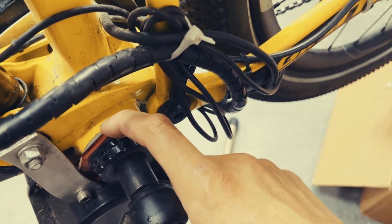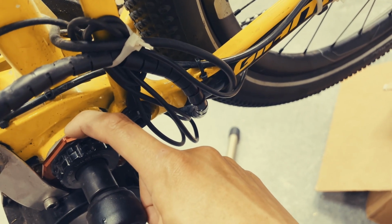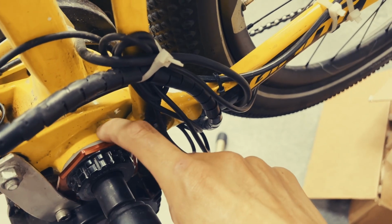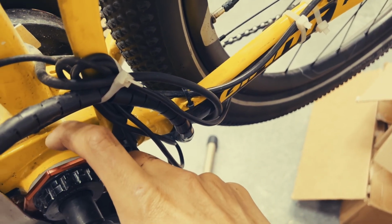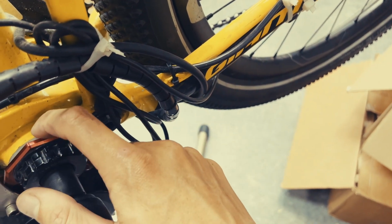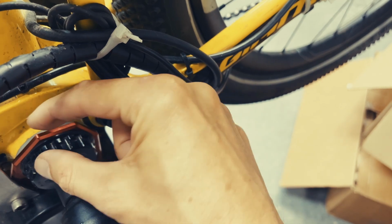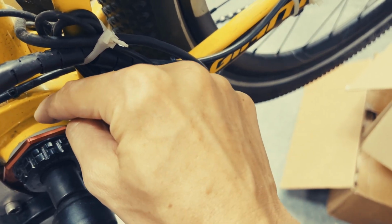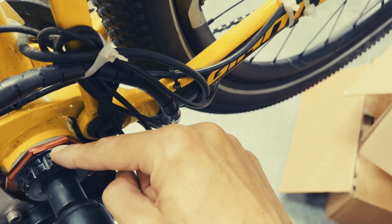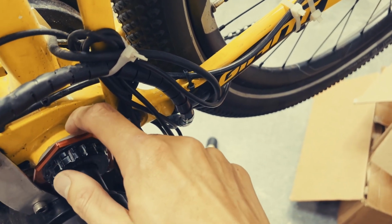So what some people do, and the link's in the description to the post that I followed but didn't follow because I didn't go their route, is they essentially, in a lathe, carved out bushings that went inside of the bottom bracket, but then also came out and created a washer between the actual mounting hardware, the spikes, on the Bafang motor nut and the frame to protect the carbon frame.